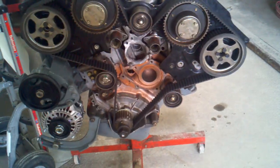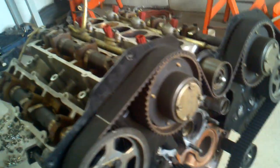It's lined up. Now at this point, if you want to feel better, walk over here, grab my inch and a 16th inch socket, which I know there's a metric equivalent to. I don't care. Put it on there. Now, once you do this, usually the timing marks won't line back up unless you go all the way back around. So you just turn everything. And if you do it by hand, you shouldn't feel anything interfere.